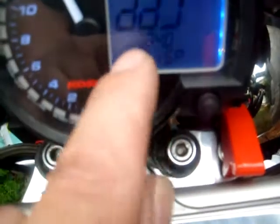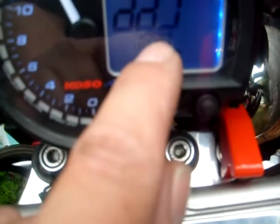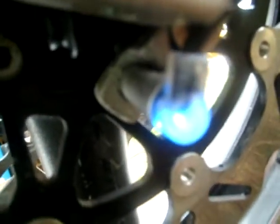There's a wheel circumference again. Remember I said mark the floor, mark the tyre, push it forward, then mark the floor again and measure the length. 1840. Sorry, 5 pickups. What I'm using for pickups are the 5 bolts there. 5 bolts on the disc, and there's my doofer, my pulse reader. Okay.